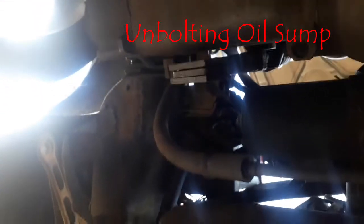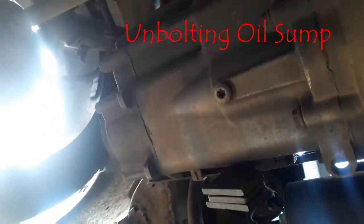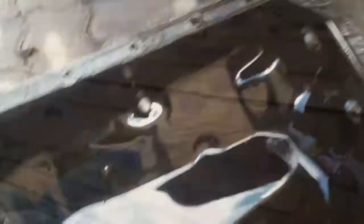Note that there are two bolts that are hidden by the cover. There's a cover just next to the flywheel - I'm sorry this video did not do justice to that part - so just keep in mind you need to take out that flywheel cover with the 12 millimeter. Now that we have our oil sump dropped, we are going to inspect it.